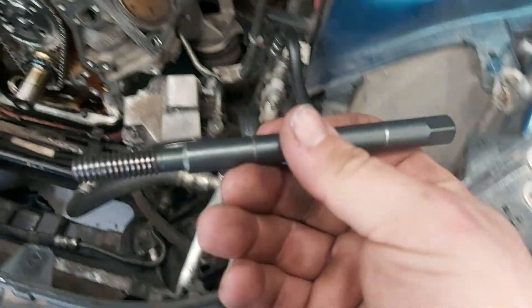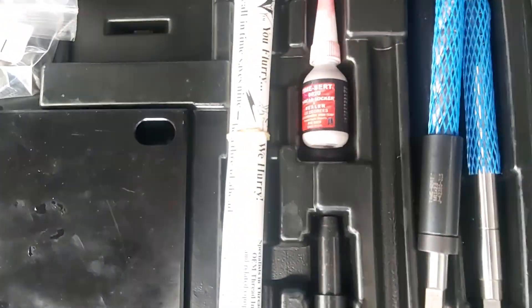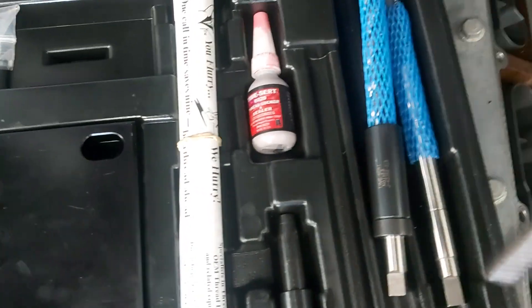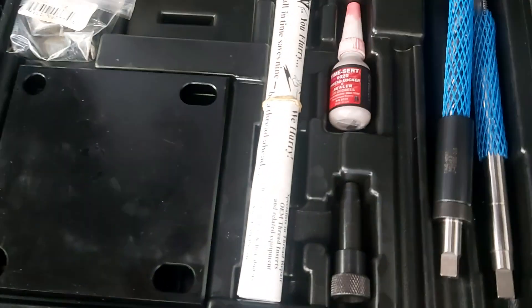So I'm going to show you the tools I use. This thing comes in a set — now these sets are super expensive. I think this one itself was about a thousand bucks, and there's not a lot to it. It's called a TimeSert Gen 3 head bolt repair set. It comes with a bunch of instructions. It's kind of like a thread repair tool — you just run it down to clean out the threads. You've got drills and taps, specific location locators so you drill dead straight, and you've got your helicoils. There's not a lot to it, but it is a super expensive tool set.